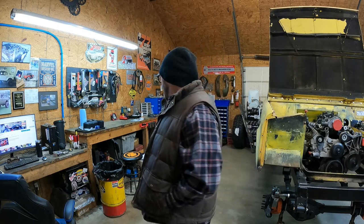What's going on YouTube, Levi at Old Iron Off Road here. Today we're going to build ourselves a rock crawler. It's been a lot of years since we've had something we could take to the trail and bash on. We're building a Scout 800 with a 4.3 liter V6, 4L80 full manual reverse valve body, built Dana 300, Dana 60 front, 14-bolt rear, 4.56 gears, locked front and rear, on 39.5 to 40-inch tires. We have most of the components — the truck, axles, transmission, and transfer case.